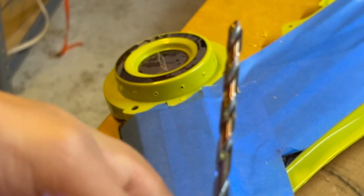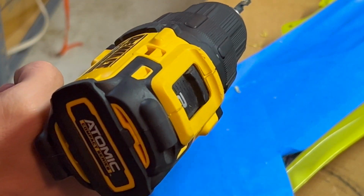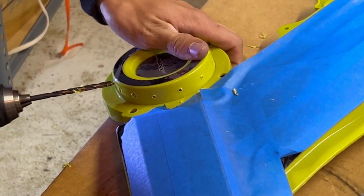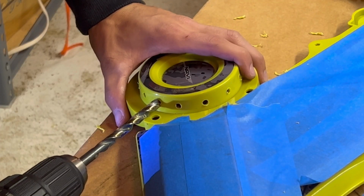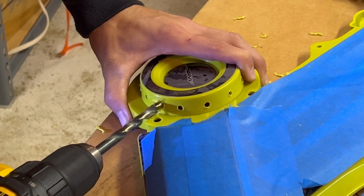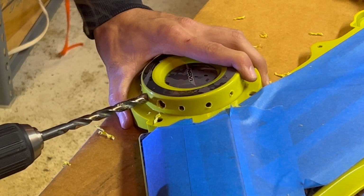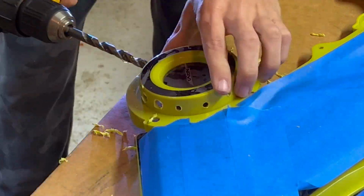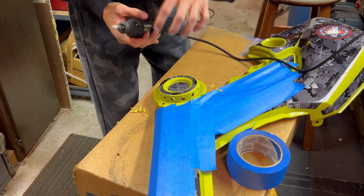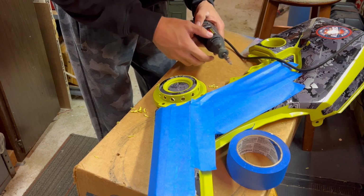You're gonna swap over to a little bit bigger of a drill bit and you're gonna go ahead and widen these a little bit for the even bigger drill bit that you're gonna be sending through here. I'll show you over here, ready? See, it's pulling itself in, and if we back it out, the back setting just cleared the hole out. So you're gonna go ahead and do that carefully through all of these. Trim up these holes, because they have flaps now sticking out. It's gonna look kind of ugly if you look down into it. So all I'm gonna do is I'm gonna go around and flatten these out and just trim them down and make them look a little bit better.